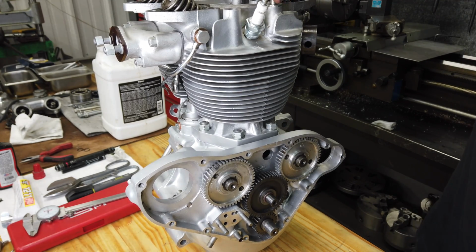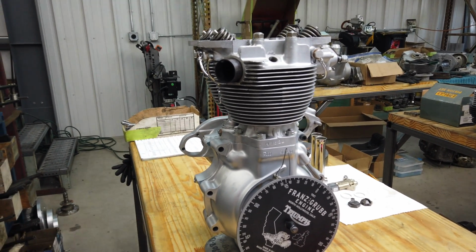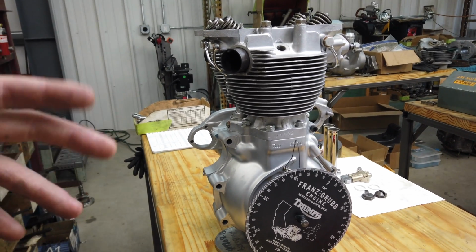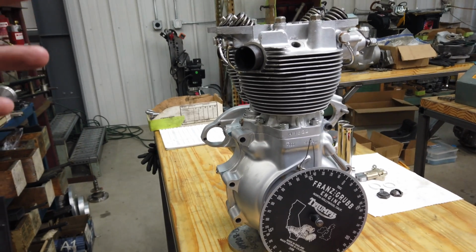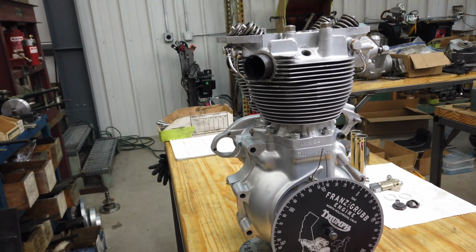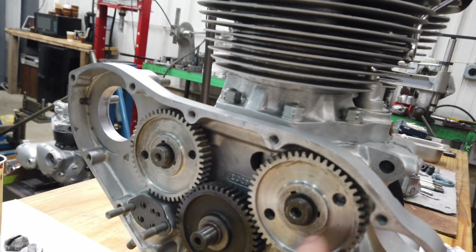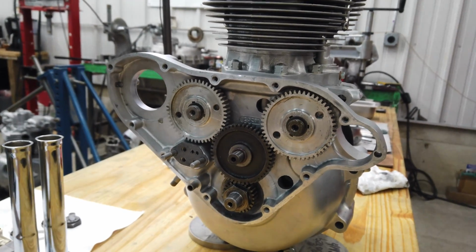Now there's a lot of leeway. So for instance, in the United States, last night I finished up with double checking my cam timing. I tried to make sure I put it back where I found it. Mostly it was because I had noticed disassembling that it wasn't on the stock timing marks. These are actually alloy gears too, so they have each keyway numbered, so they're kind of set up for degreeing.